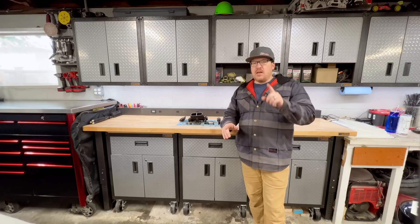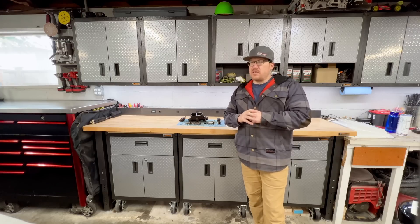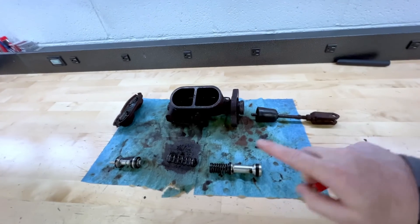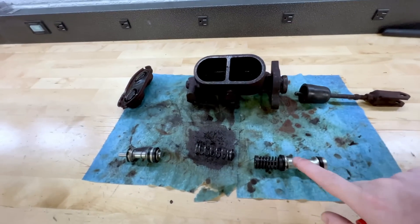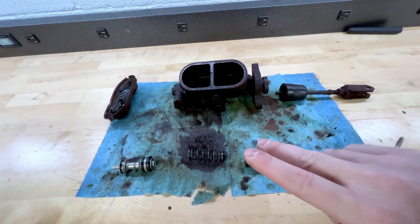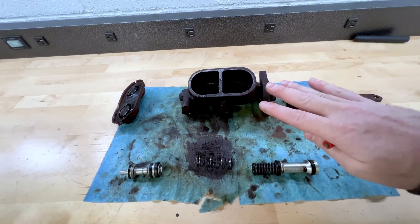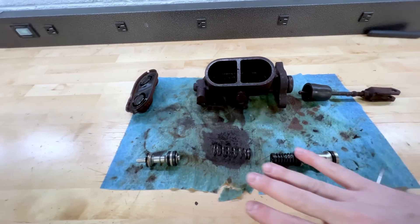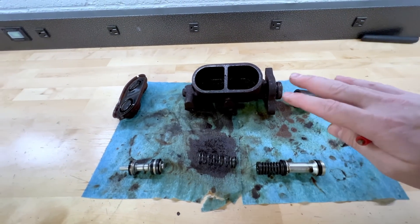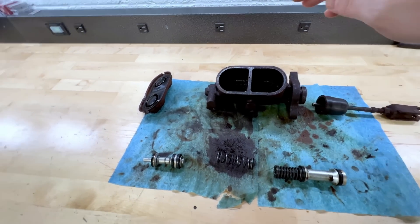That's not what we're talking about today. That moisture does something more serious and more damaging inside those lines — that's what we're here to talk about. You can see that I have this master cylinder fully disassembled with all the pistons out of it. These blue shop towels were completely clean before I set this on there, so everything on these towels came out of that master cylinder — all a result of the moisture in the fluid causing corrosion inside.